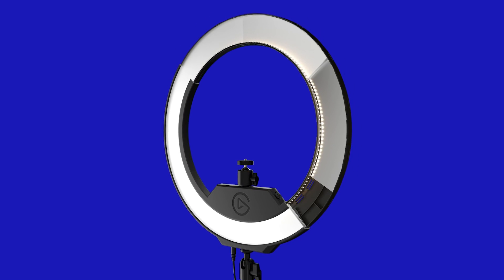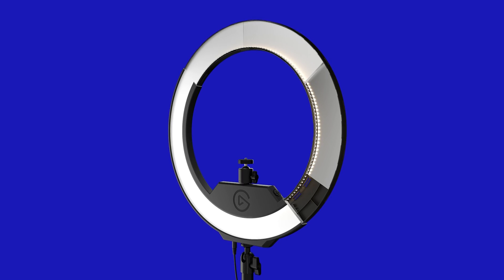Next, let's talk about the technology that makes Elgato Ring Light so great. Not only does Ring Light feature the very same high-quality Osram LEDs as Keylight, but it is also the very first edge-lit ring light. In conventional light panels, LEDs shine directly toward you, which results in a harsher light that's prone to causing eye fatigue. But with Elgato Ring Light, the LEDs line the inner circumference of the frame while shining across the reflective back panel. This indirect lighting method combined with three diffusion layers results in bright yet soft illumination that's free from visible hot spots and easy on the eyes.